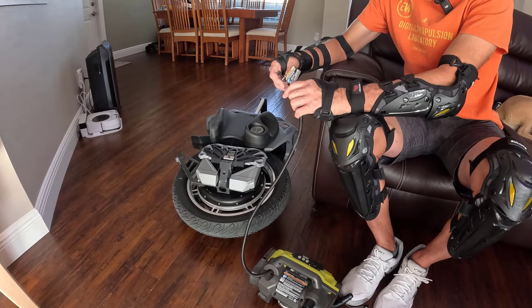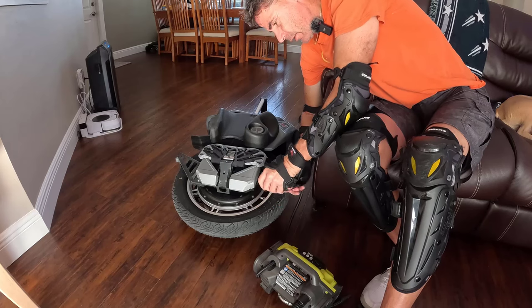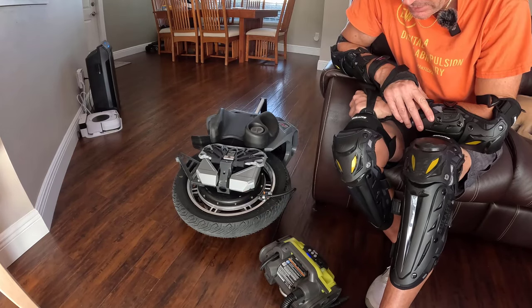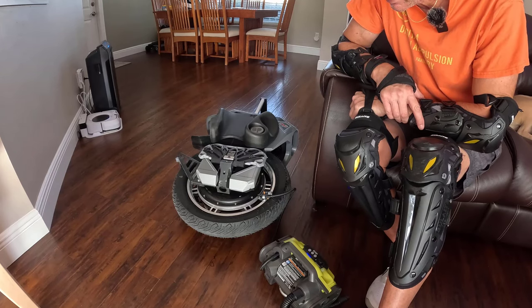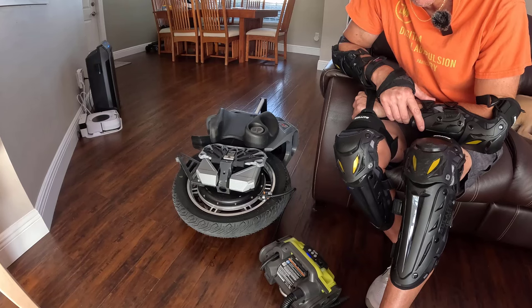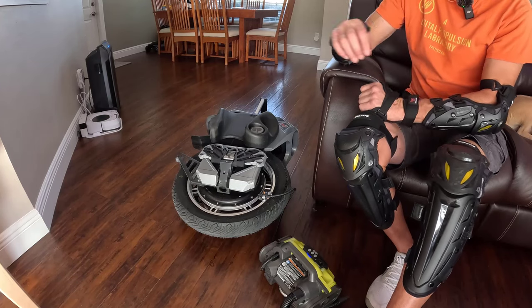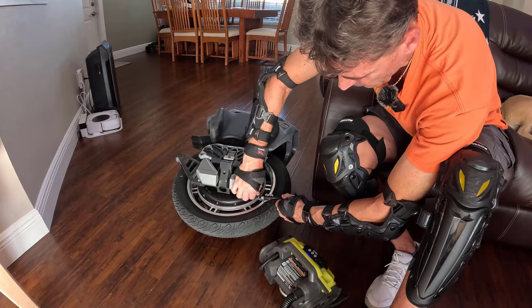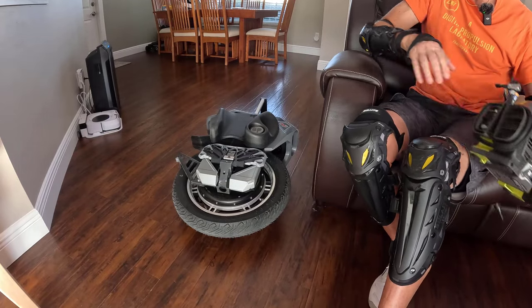All right, we're checking the tire pressure. I have not done this ahead of time. You are seeing it at the same time I am. It's the exact same. Actually, it went up a half a PSI, I guess from the tire being warm. It was 30.5. Now it's 31. So it has lost nothing. So the tire survived all of that without an issue, which makes me confident that the tire itself is pretty dependable on this rim.